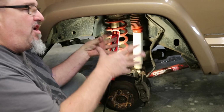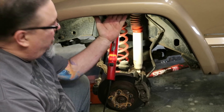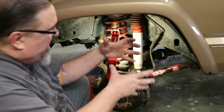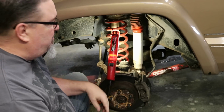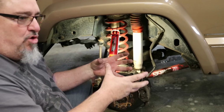So the Jeep is tall and skinny, it's easier to tip over, but there's a little more room. That's some of the parameters we were talking about earlier. The tire can move in and out up here a little better, but as soon as we get that wider stance that we want, now instead of being able to fit up behind there, it comes up and hits the flares much sooner. If you want to have the stability and full lock-to-lock steering, you need to go wider.